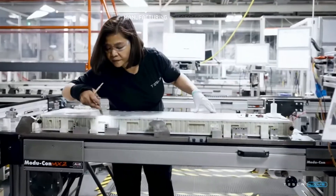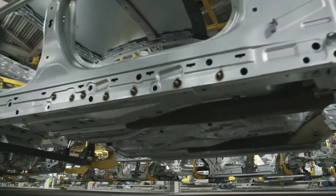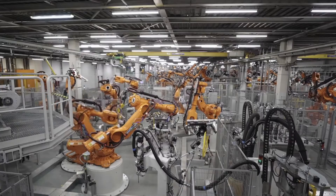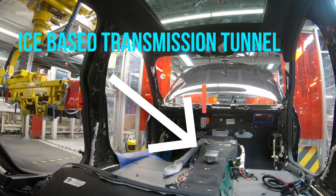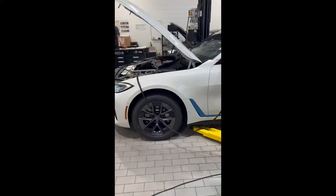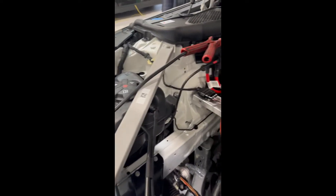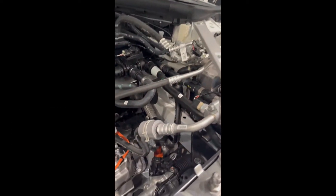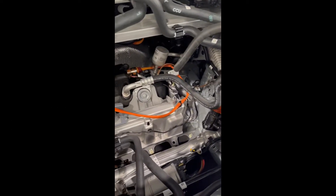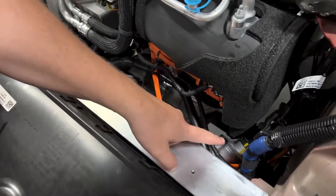This really pushes them ahead of the competition, especially some of the legacy automakers. Many traditional automakers are producing their electric cars on the same platform as their internal combustion engine cars, utilizing their current assets. However, it prevents optimization in such drastic ways as Tesla, because the cars are not built to be electric from the ground up and cannot move away from ICE-based design. Take for example the BMW i4 — it uses the same frame as its petrol M4 model. Under the hood you can see a lot of pipework running all over the place, because it's not integrated from the ground up; it's put together almost as a conversion from the petrol model. All these pipes and extra lines need extra power to pump and are less efficient due to heating and cooling losses in the circuit, adding to the cost and decreasing range. Compare this to Tesla's heat pump design and it becomes clear which technology is in the lead.